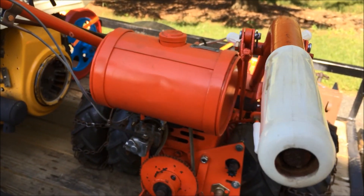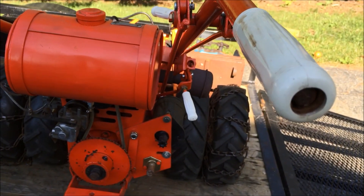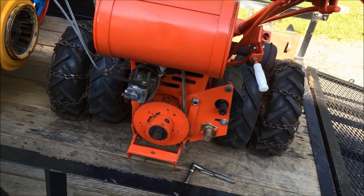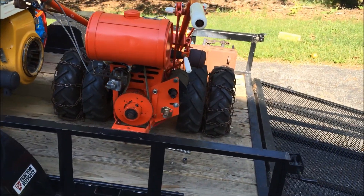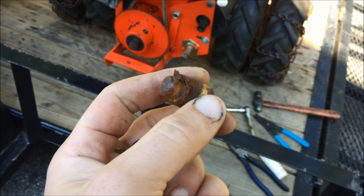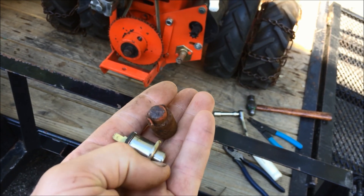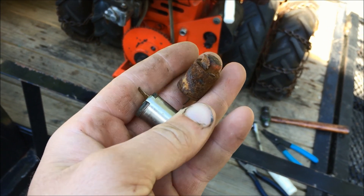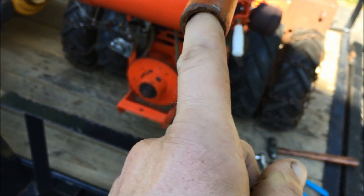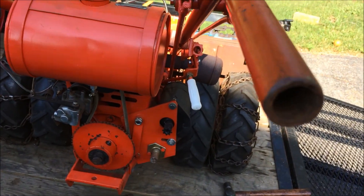I'm going to take off this handlebar grip, pull out that switch, and put a new switch in there before I put this away in the shed. I just got to hook up that starter cable and drop a chain on there, then maybe we can jump start this thing instead of pulling my shoulder out. This was the old kill switch - this whole ring around the top is totally gone. We'll plug the new one in and I'll just sand this rust out a little bit so it has a nice contact to ground. I might take my Moto tool with the grinding wheel and just go around it real quick to clean that up, then we'll drop in the new switch.